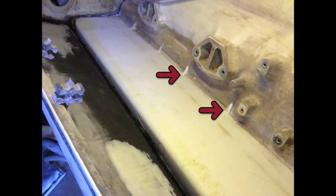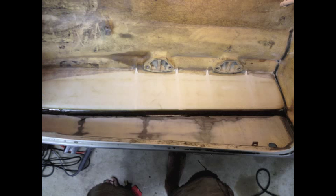Here's the epoxy curing in the bond line. I did this in two stages — the ski on its side to get the back half of the bond line, and then to get the front portion I actually raised the stern a little bit so I had a nice smooth transition from front to back and from the bottom of the hull to the top, so that the material will lay nice and flat across there.